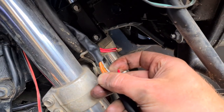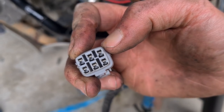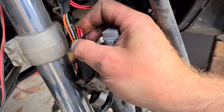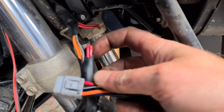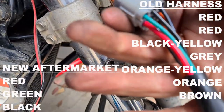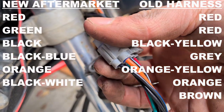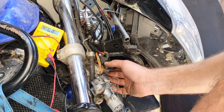I'm going to need to pair these wires back and make some connections myself. This one off Amazon came with a little harness, but I don't think it's necessary. I'm going to look at whether the color coding on these wires looks to be the same or if there's going to need to be some guesswork. On the old one I have two reds, a black-yellow, a grey, an orange-yellow, an orange and brown. On the new one I have a red, a green, a black-blue, an orange, and a black-white. So that's going to need some forensic work. I'm going to need to work out what each of these does and where they go to try and match them.